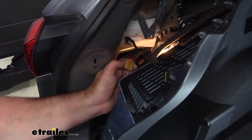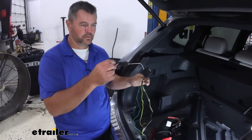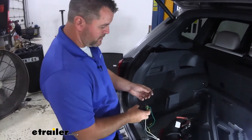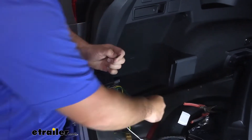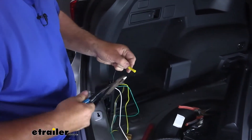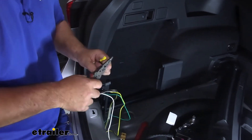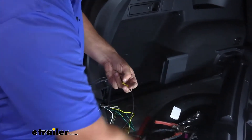You're going to do the same thing on the other side of the vehicle. Before we go any further, we're going to take our wiring harness and the bundle of wire that comes in your kit, and go ahead and attach the two together. You're going to have a short black wire that comes off your converter box that's stripped. Take one of your butt connectors, add it on the end, and we'll take one end of our power wire, strip it back, and add in the other end.